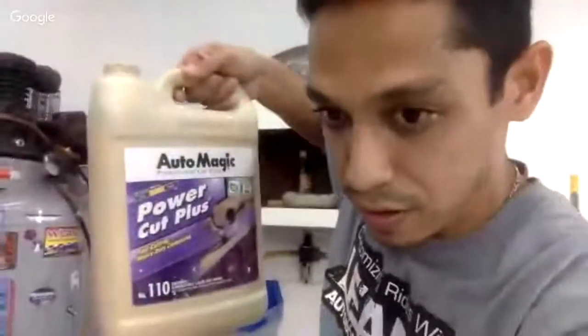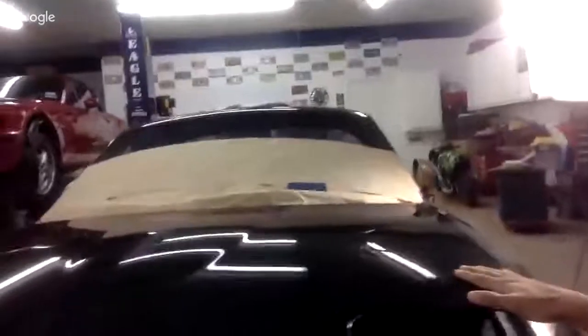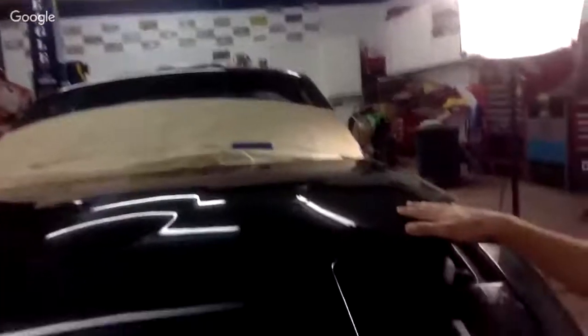After compound polish, do you still get haze? What am I doing wrong? You're not buffing enough. You're not buffing with your compound enough. Your haze has to come out with this process, with the buffing compound process. All right, and then the swirl mark remover will basically brighten up everything. And when you look at it like this, it's super glossy now.